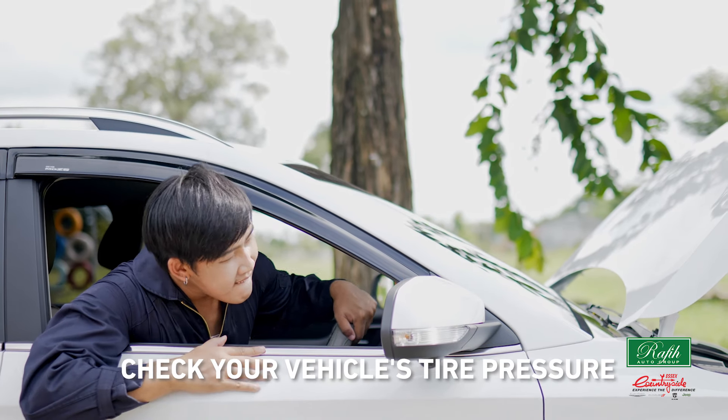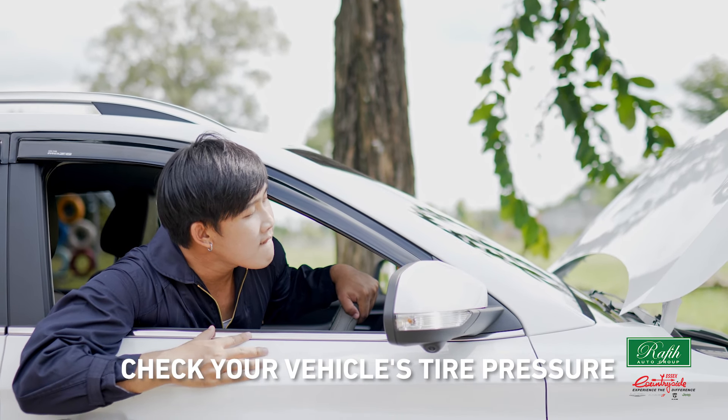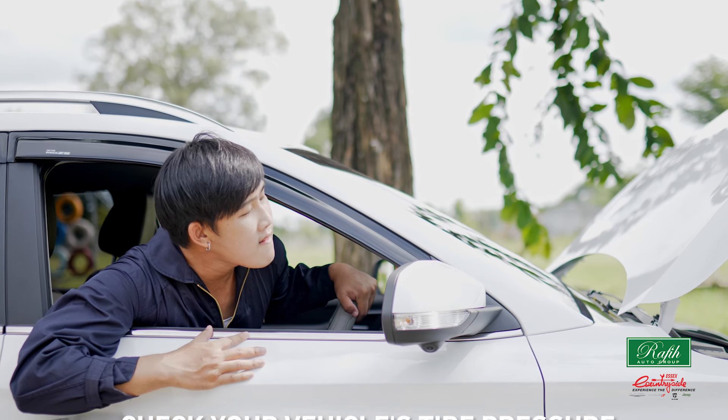Fifth is to check your vehicle's tire pressure. You can remove the valve stem cap and stick a gauge firmly over the end. Make sure it seats well and no air leaks out around the edges. It's best to maintain the factory recommended pressure displayed on the placard, usually on the driver's door jamb.